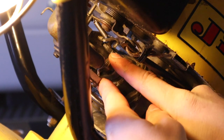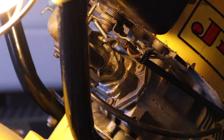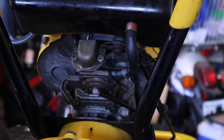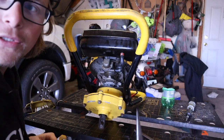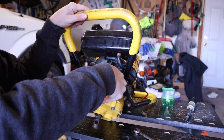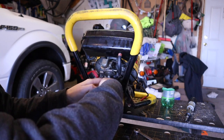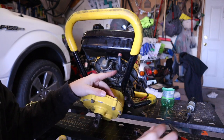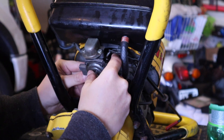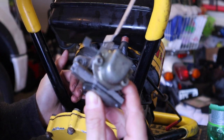Make sure you're working somewhere so if a bolt falls you can find it easily. Right up here is where the fuel comes in from the fuel tank, and right below it is the drainage. All we're going to do is pull this hose clamp back, grab it with our needle nose pliers, twist it a little bit, and this one should come out. Make sure to drain your gas tank before. Next all we have to do is disconnect the drainage from the carburetor — that one comes out easy. Now just wobble it a little bit, angle it up towards the gas tank, pull straight down, and our carburetor is out.